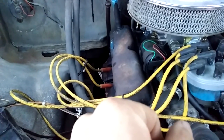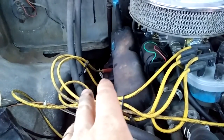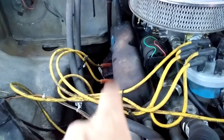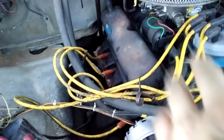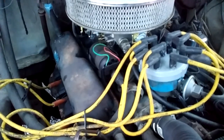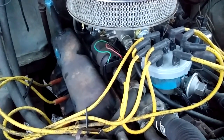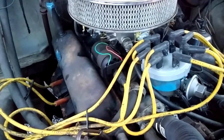the valve spring is done come loose or something on this side or what, because it's not an exhaust leak. I narrowed that down. It's definitely not an exhaust leak. And I thought the worst thing too, I thought it was like a cracked exhaust manifold, and it's not that. It's nothing like that. It's coming from underneath the valve cover here, so it can only be a couple things. Either it's that valve spring in there, it's done come loose or something, or maybe that rocker arm's not opening it up all the way, or the valve stuck or something.